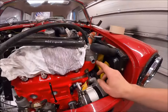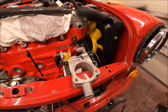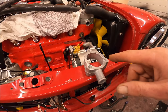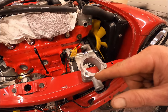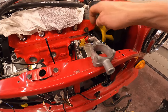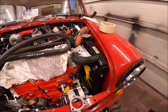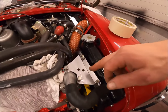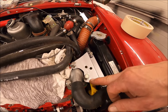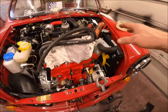I've had some big issues with the thermostat-held-in sandwich plate. I've got this sandwich plate from Mini Spares - the holes were too small, they don't line up with the cylinder head. So I've had to clean the old one up - it was really tatty - and now that fits okay. There was a split all the way through on that, so I've had to weld that in and respray it, so that's all good.